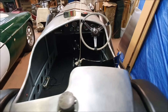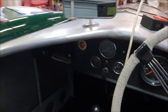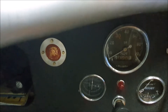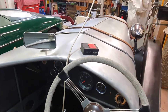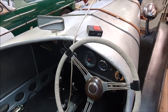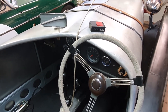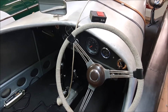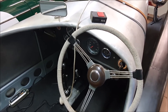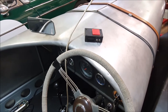The other thing I've been playing with is the speedometer on the car — and if we get close you can see it's actually in miles per hour, and it works. I don't know if it's accurate though. It's cable driven, so as long as the ratios and gears are all correct it should be fine — it does depend a little on tyre size. I want to be able to check that, and I can use the GPS on my phone, but because electronics is a hobby of mine — actually that's not fair.